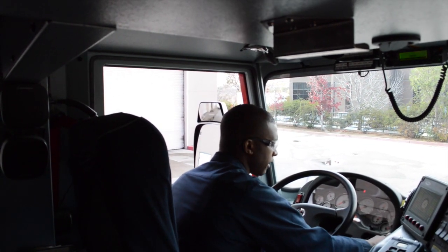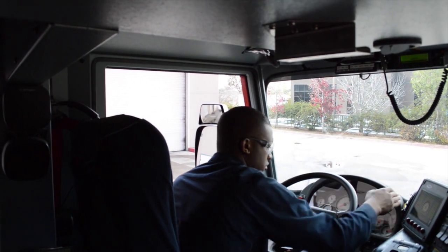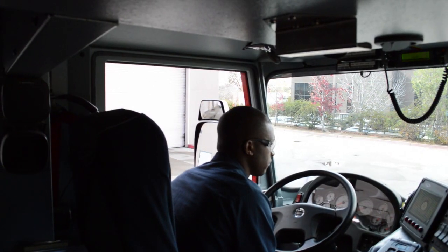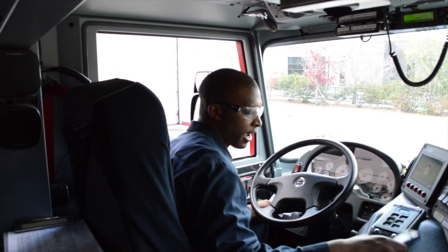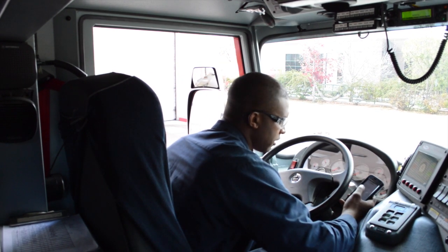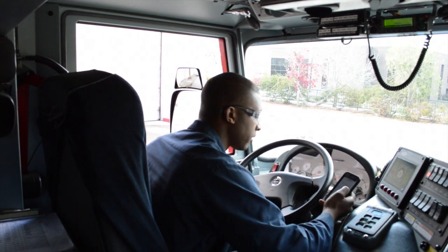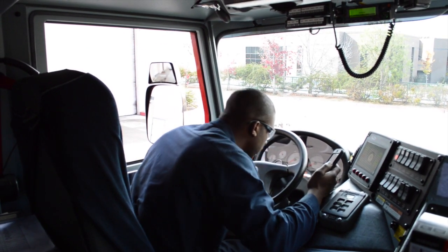Now that my air pressure is brought up and my engine is not running, my ignition is on. I am going to release the air brakes. You should have a low warning alarm because your ignition and battery switch is on. The first step is to check the static air pressure. You are going to set your timer on your phone or a stopwatch for one minute, and I should have no pressure drop in that time. We can stop our stopwatch and take a look at our gauges and make sure we had no drop.